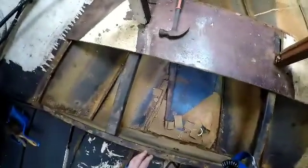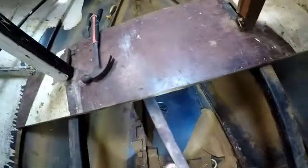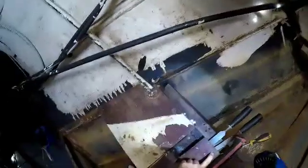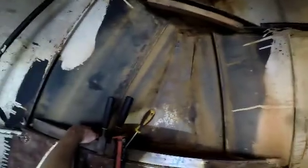This section here, I've only just pulled this section of floor up, and I've left it just to give you a look at what goes on. None of the other sections had this sort of stuff in there. I'm not 100% sure what it was for. I'm guessing there was packing between the ply and whatever maybe was under it. This is the only bit of floor I've got left to get up. This little situation here is a common situation throughout the whole demolition, if you like. We've got steel or 304 stainless, maybe 316, probably 304 screws going through the ply into some frame, whatever, timber.